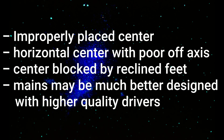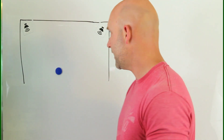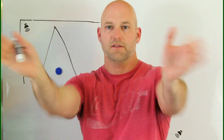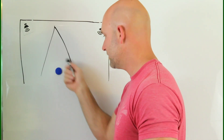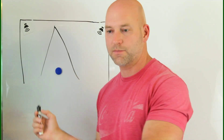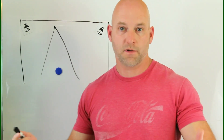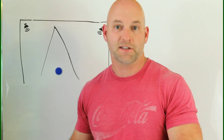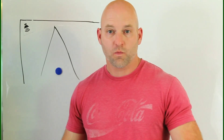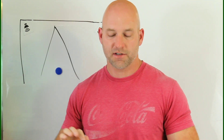However, as you move off-axis from the sweet spot, that phantom image narrows. A center channel sends energy across the seats to cover more positions. When you don't have that center and you move out of the sweet spot, you're going to notice it. So this isn't something you'd want for a full home theater — it's for the two-channel listener or if you only care about a couple of seats. Do not think I'm suggesting you shouldn't have a center channel in a dedicated room with several seats.